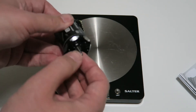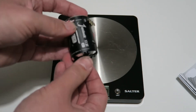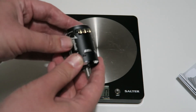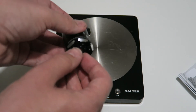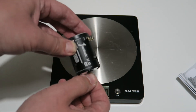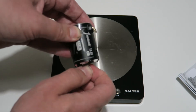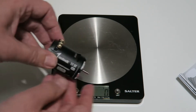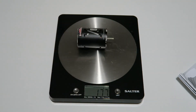Partly because of the reduced ventilation, it does weigh a little bit more than some other motors — about 15 grams more than the Surpass motor I was using previously when the rules allowed open 17.5-turn motors. The other thing I noticed is that this motor doesn't have as much rotor strength as some other motors used more recently as competitive motors, which probably has an effect on performance. The motor weighs in at 177 grams.